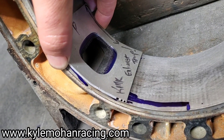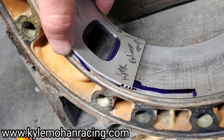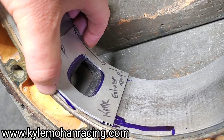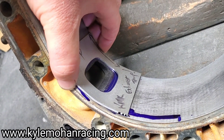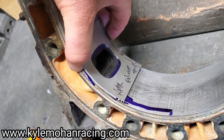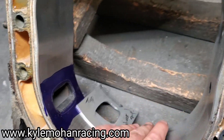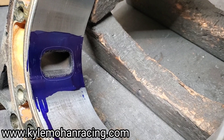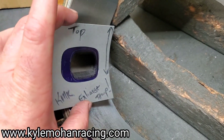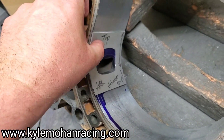Your middle mark could be your basic porting, that could be your turbo, that could be your NA — or any infinite combination of possibilities. That's the point of my porting template. As a race porting template, it gives the user, the engine building master, the opportunity to apply this to their own existing knowledge of timing and templates, or create repeatability based on whatever data they do collect. That kind of breaks down two of those cool questions that got asked, and a little bit of how to use a basic exhaust porting template — or the KMR porting template for that matter — and why I don't offer a fixed position porting template, because to me this has way more value than one that has a permanent position.